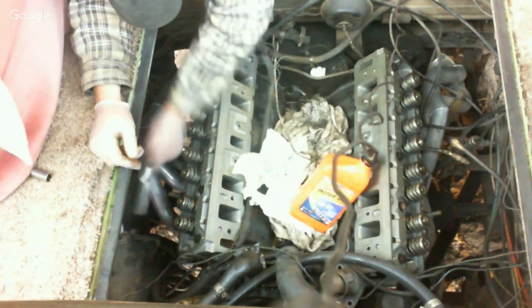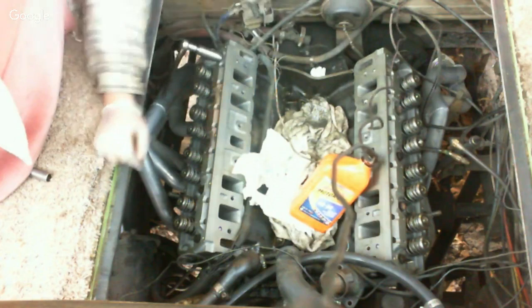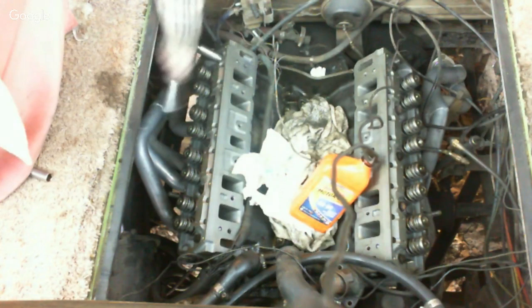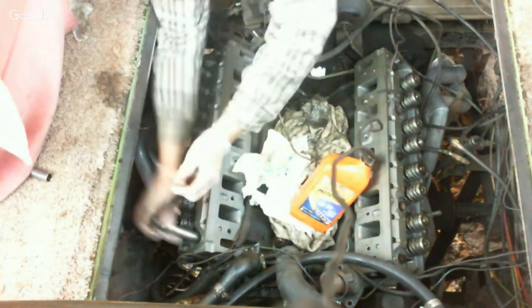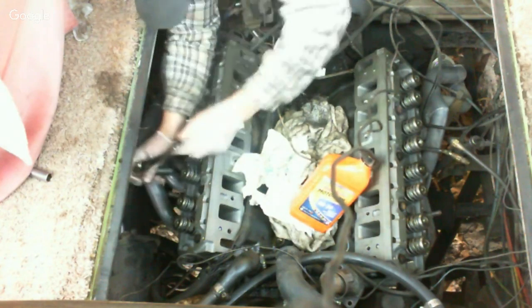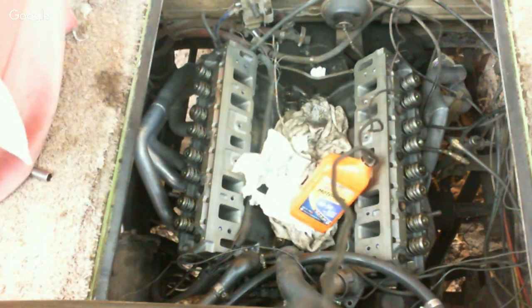And get the head bolts torqued down. I'm going to get the rocker arm assembly on and show y'all how we oil that up and everything. Once I get the motor together, not counting the distributor and carburetor, I'm basically going to prelube the engine a little and just make sure I get some oil circulating here. But I'm not going to get that part in for tonight. That will be for another day.